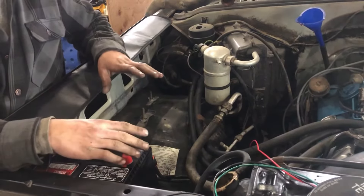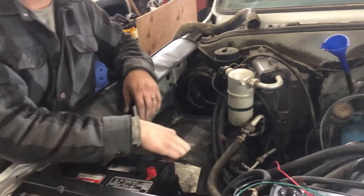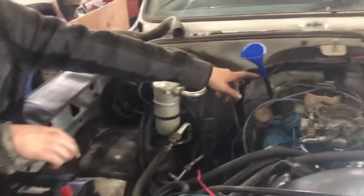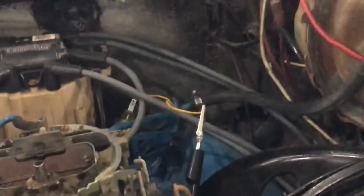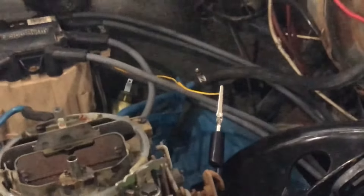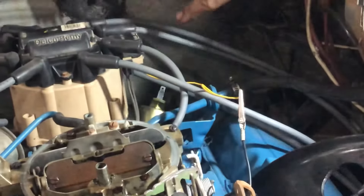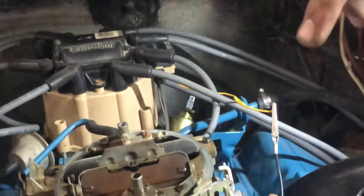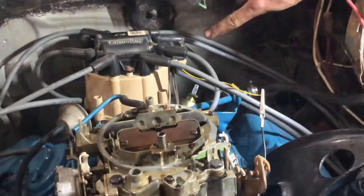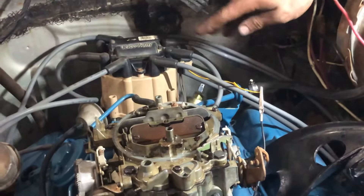Actually, don't touch that one to the positive right away, just let it sit over here. Then you're going to grab another wire and go straight from the positive on your battery to your distributor. You'll see the little box on the side — this little yellow wire right here, I kind of have it jimmy-rigged — it'll actually say right on the distributor 'battery.' Just go straight from the positive to there on your distributor and that'll give you power for your spark.